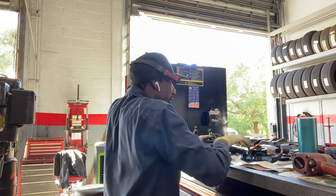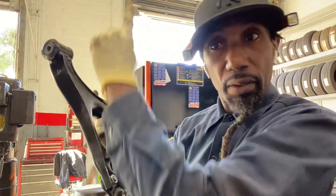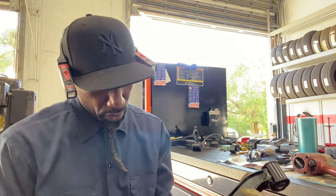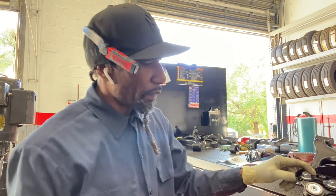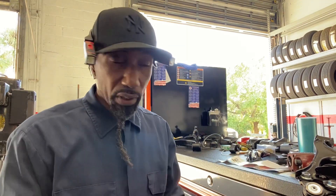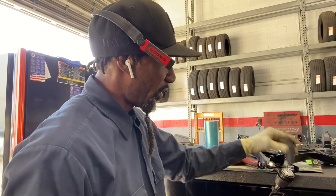So we have our new control arm here. You can try to put it up, have it tightened first, and then put the arm in in reverse fashion — I think that would be the best option. You say to yourself, 'Exodus, I don't want to disturb the ball joint.' It's new, they may not warranty it. But the headache you're going to face with the axle — trying to tighten the bolt between the axle and get the arm in there — that's why they designed it to separate. I know how to make my job easier. The old man would say: work smarter, not harder.